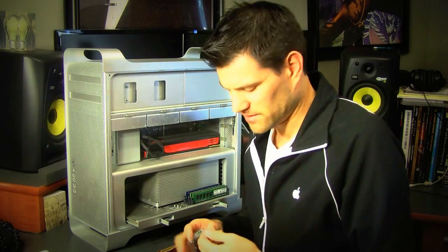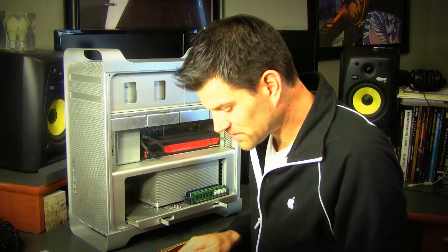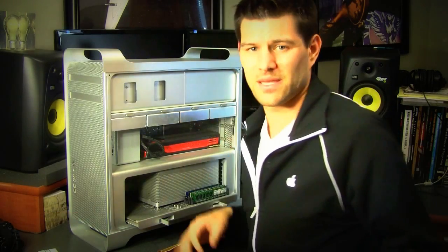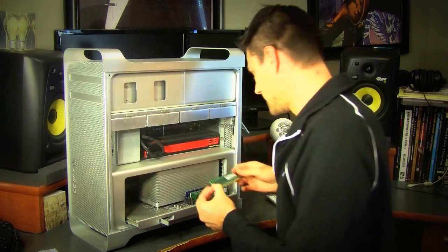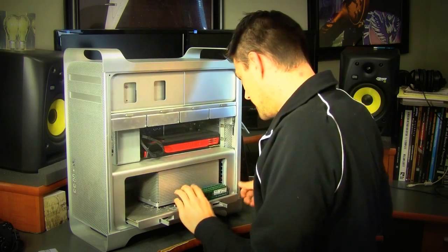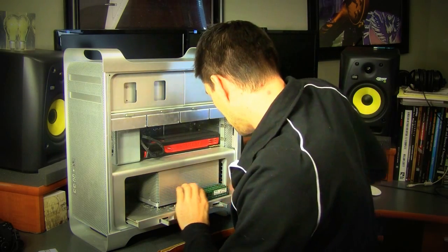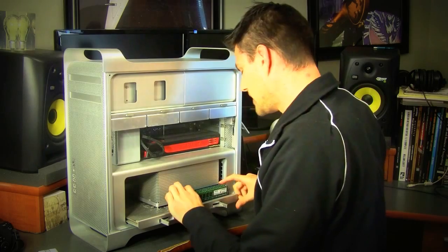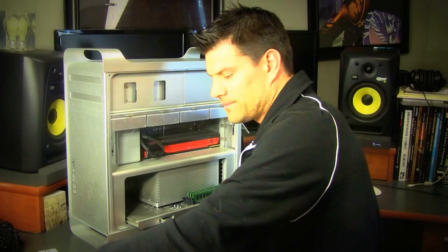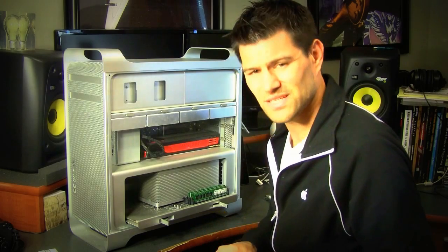What computer system doesn't have easy-to-get RAM? I shouldn't say it's just Apple — that's a little biased. But they do make the ease of use a little bit easier than some systems, because some computer systems can be very difficult to get your hand in. Here it's just a little slide, you pop out, pop in, and you are done. I'm putting this stick right here in what looks like the third slot. If I did not mention at the top of the video, this is the 2010 quad-core Mac Pro edition, and it has four slots of memory. I think I can put a total of 16GB in it — I could be wrong but I'm pretty sure the max is 16. So right now this is going to put it up to 12.